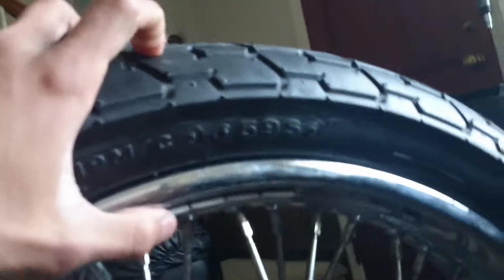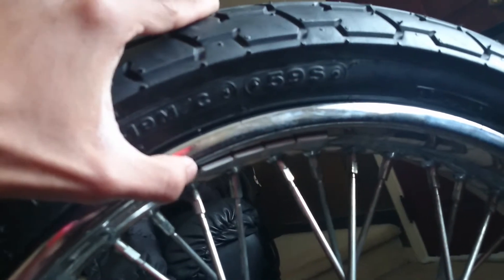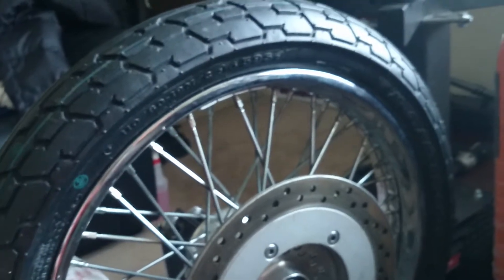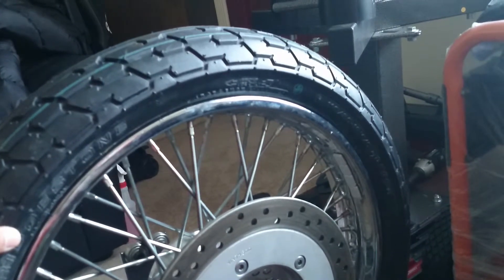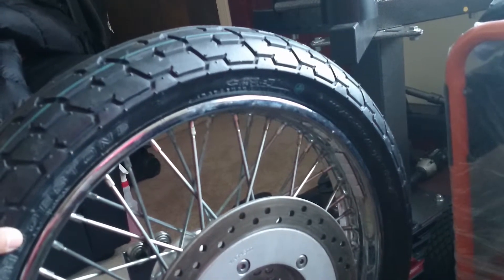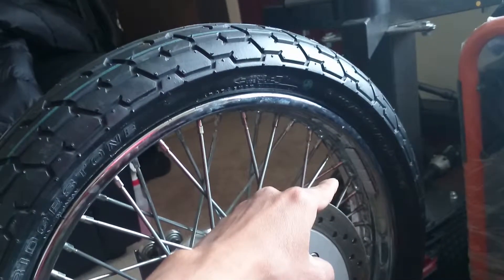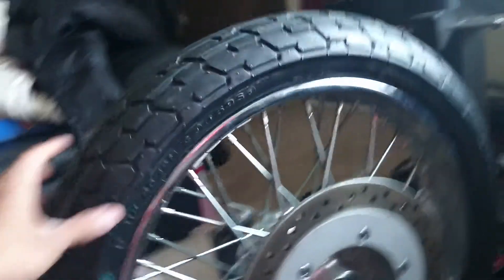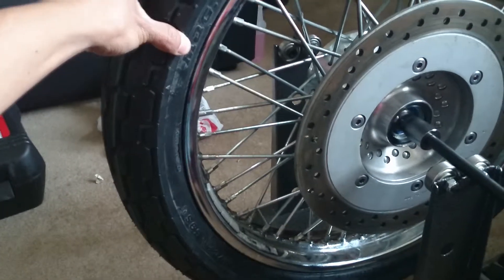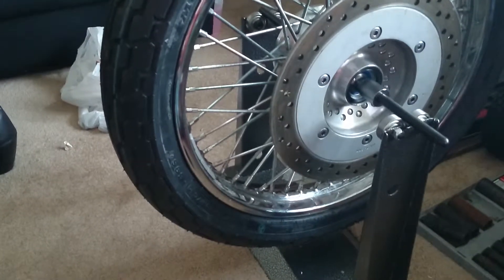As you can see right here, I put four weights and each of them weighs 7 grams, so I put 28 grams in there. After you put the weight in, no matter where you place the tire it just stops — it doesn't go back to the original light weight position. You can check from any side and it stays.